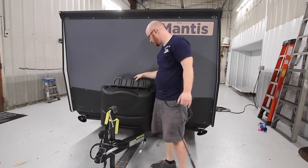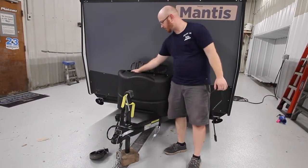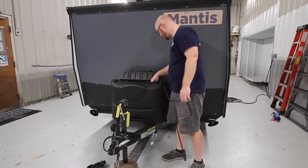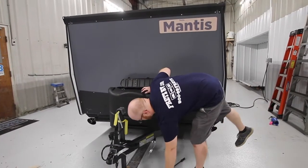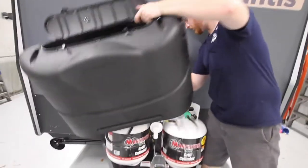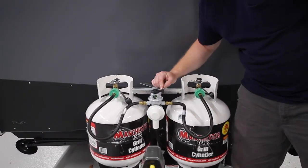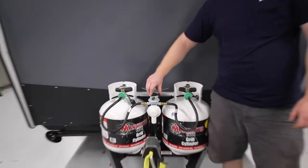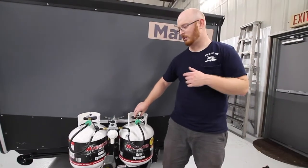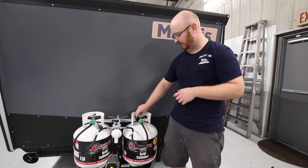On the front we have two 20-pound propane tanks with covers held in place with bungee cords. Spin the valves to the left to open them, to the right to close. You have an optional left and right tank selector showing 'supply' on the regulator — if one tank goes empty, switch it over to the other tank, and then take the empty one to get filled at your regional propane distribution area, like Fretz RV, Home Depot, Lowe's, and so on.